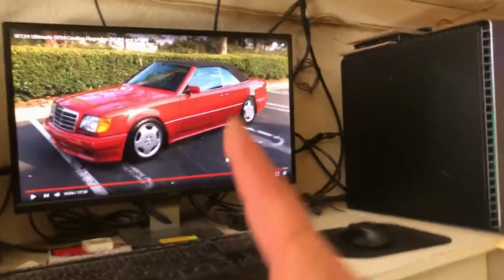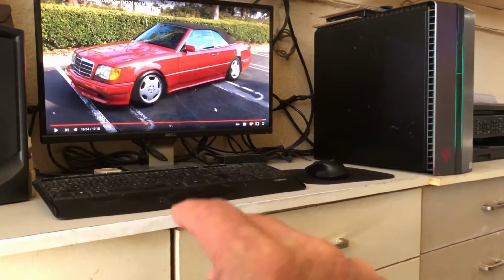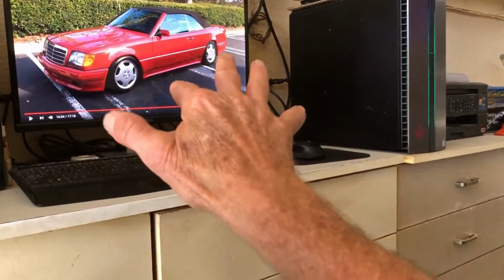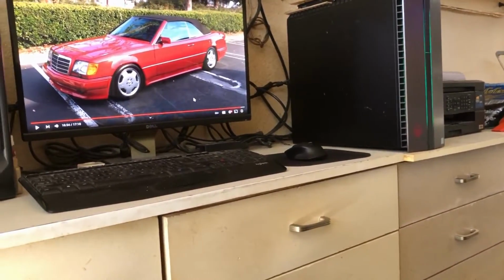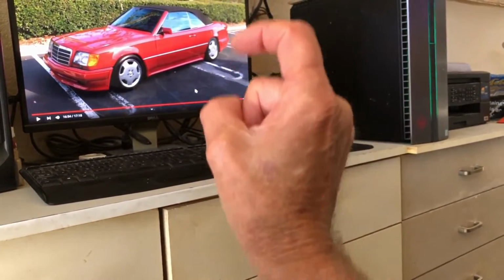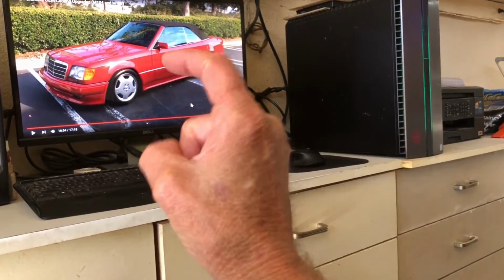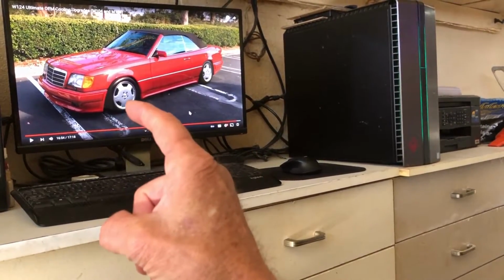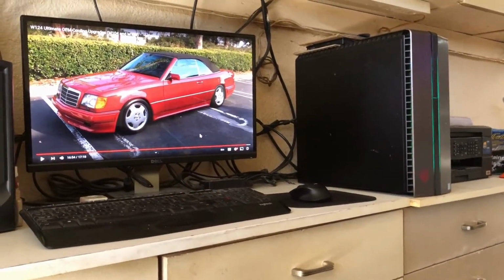The temperature on that digital readout, at least on mine, okay. Well, mine runs cool. What is that temperature? There's no overheating or anything, outdoor temperature. But during the summer, when it says 90 degrees on that thing, or 95 degrees, that's when that engine will start having issues. Stop and go traffic, drive through, prolonged idling, air conditioning on. That's when it has problems. And that's when I need that tropical fan clutch.